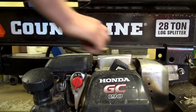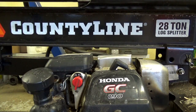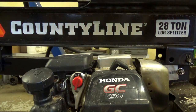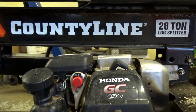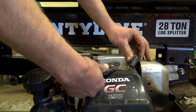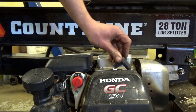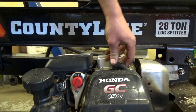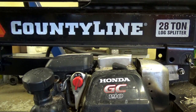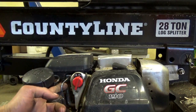We're just going to tighten up the top screw terminal on that to make sure it doesn't work its way loose while it's running and cause mini arcing. All right, stick our boot back on. We've got our ignition switch in the on position and pull the choke out.